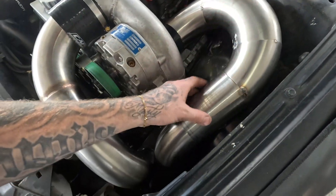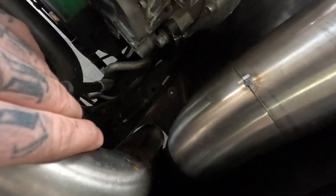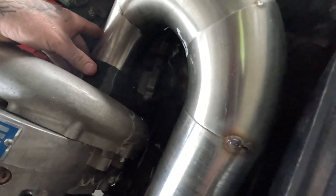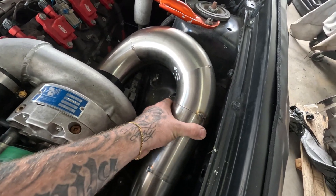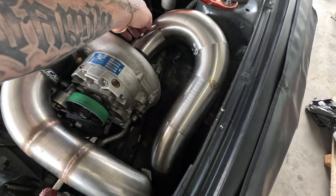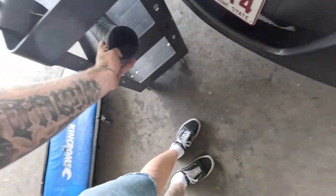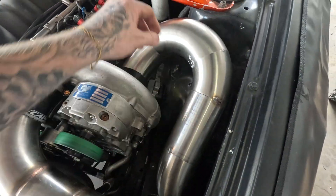That's all roughed in. I'm going to open the hole up a little bit more down the bottom - the intercooler pipe still fits which is good. Got a filter on there now. Yeah, I'm really happy with that actually. Just need to make a bit of a mount to sort of hold some of the weight of it, rub them out, mount the ECU up, get it all final fit back together. Yeah, it's probably pretty excessive for an intake but it looks cool, it's going to sound cool, going to be a lot better than what was on it. We'll weld it out and see how it looks.